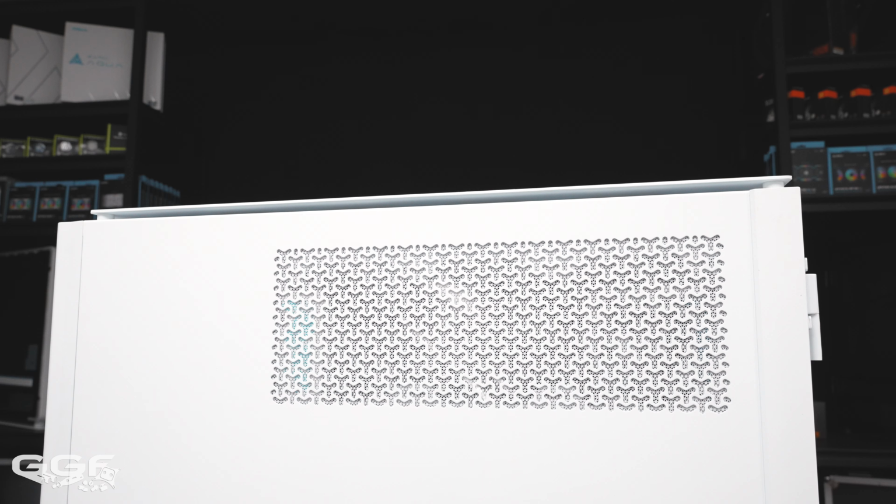I ended up running two system hubs from Corsair. The case does have one. Although iCue Link can now support 24 devices, I just ran two just to make sure, because I'm pretty close to 24 devices. I've got the dual GPUs, a heap of cables. It is a little bit messy down the bottom, but that's expected on such a large build like this.